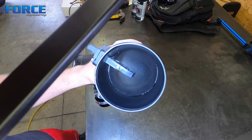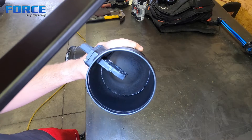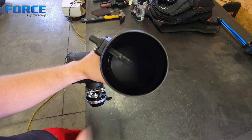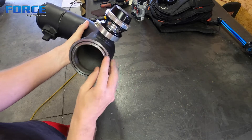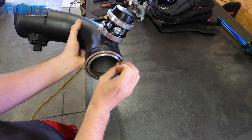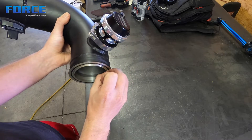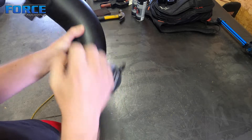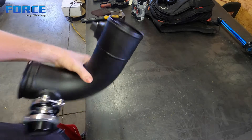You can see it's just right in the way — like where a mass air sensor would go, right in the damn way. So I'm going to pull the mass air sensor off, pull the blow-off valve, pull the O-ring out of the flange here. I'm going to cut this off right here, add another piece, prep it, so I can get rid of that.